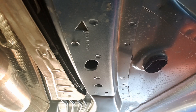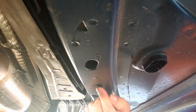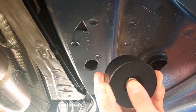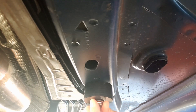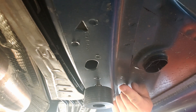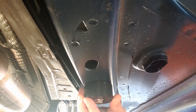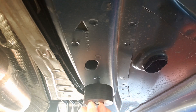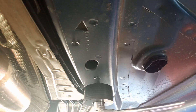I'm going to do the passenger's side puck first. It's going to go in this opening right here — you can see the triangle. If you just work your way towards the rear bumper, you can see the opening where it's going to go. You're going to install the bolt in the opening just like that, put it up in there and just start threading it in. It's a 15mm bolt, so you need a 15mm socket. You can just tighten it in by hand a little bit to get it started. Before I go any further, I do recommend cleaning off this whole area around it so you don't have any debris stuck on the car that could bite into the puck or into the car. Both sides go on the same way — just screw it in and take your socket and tighten it up.